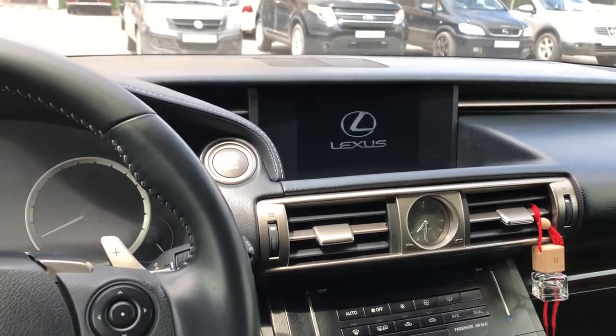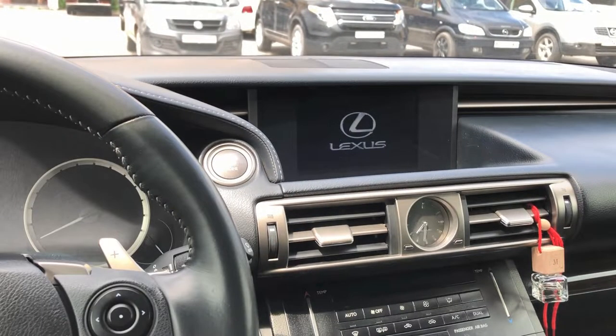Done. Now you can start the engine normally with the brake pedal. To avoid this problem, just push the start button without the brake pedal the first time after battery removal. This happens after a long time without a battery or if the battery was discharged.